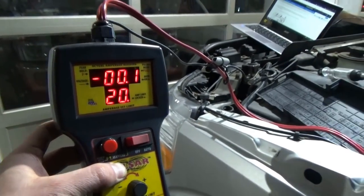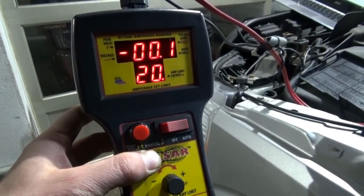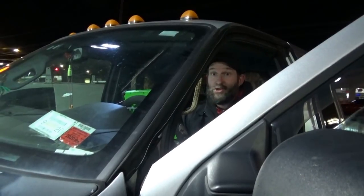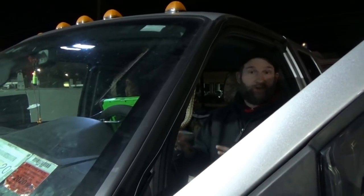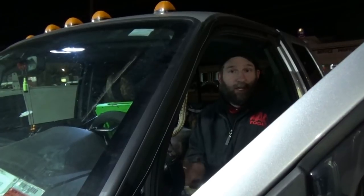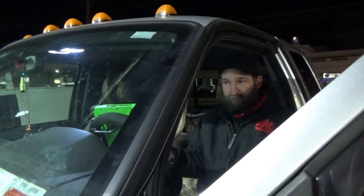There are other power feeds to the trailer brake module though. That one fuse is basically out and there's like a pin stuck next to it — don't know what that is. We're going to disconnect that. Don't know what it is, should not be connected to the airbag circuit. For all we know, whatever that is could have shorted out and blew this fuse. Everything we're testing looks okay — modules are awake and alive. Pull it out, make sure everything's good, start from there.